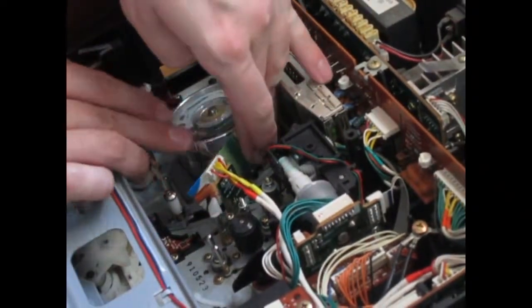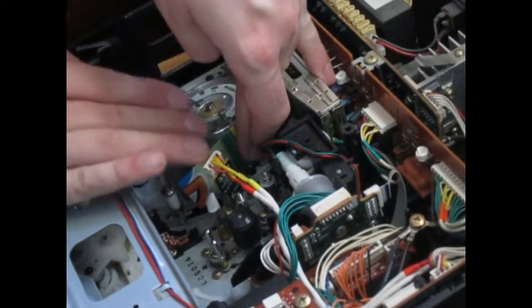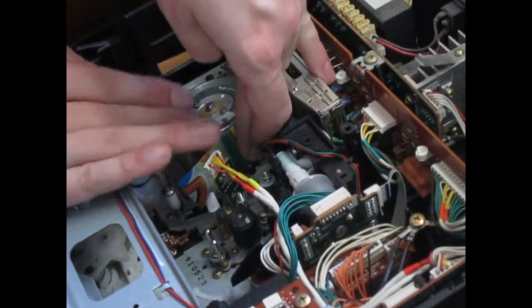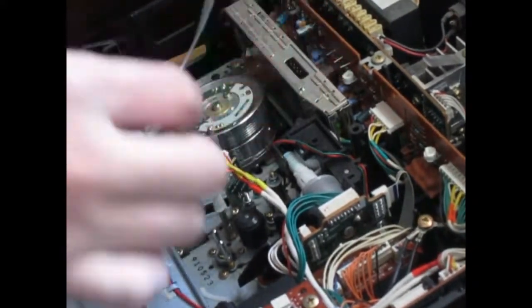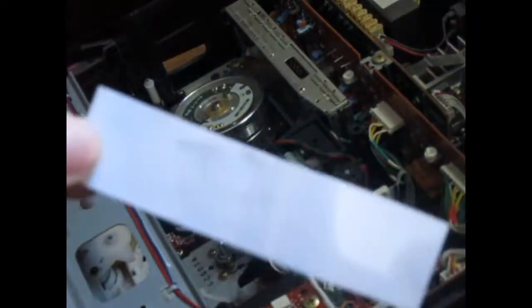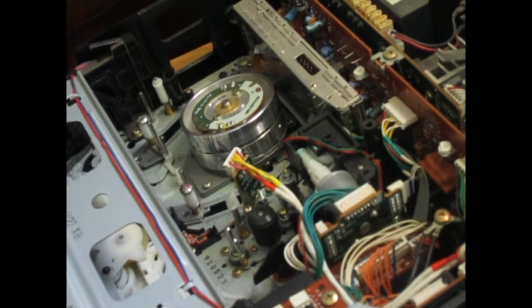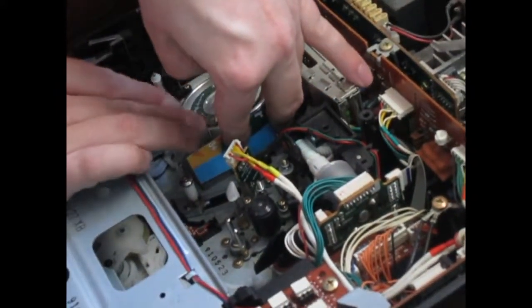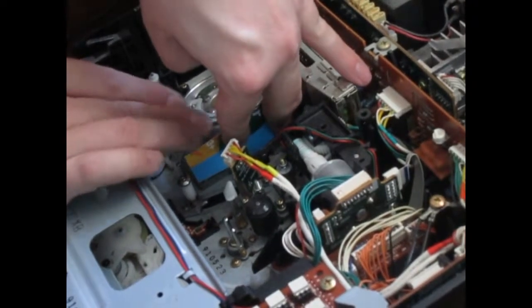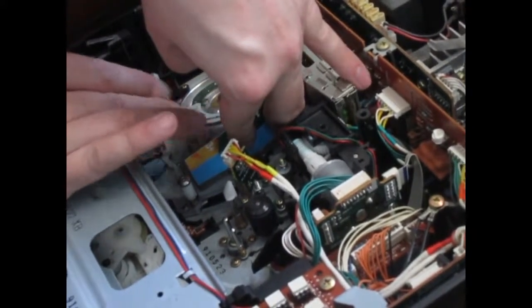I'm not too worried about overdoing it with the video drum. It's just the audio and recording heads, because the Q-tip, that stuff can get inside. Doing a little up and down, but not too much there. That one looks surprisingly a little dirtier than the first one. And now for the last one. I'm pressing hard but not too hard against this thing. Okay, there's a third strip.